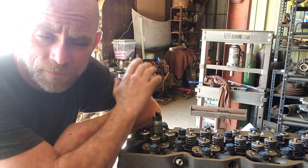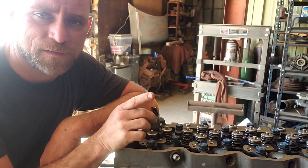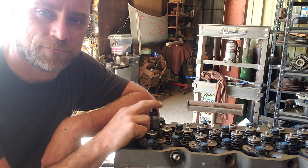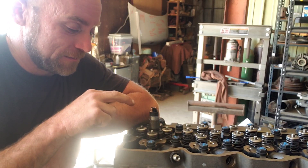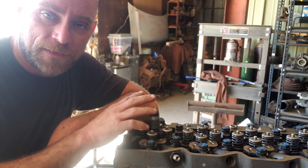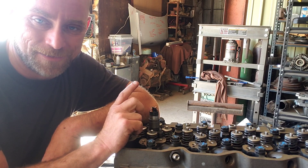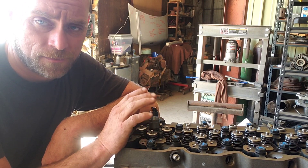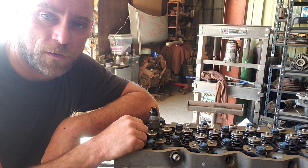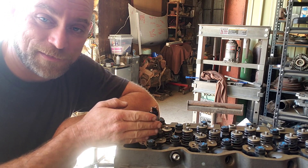The point of this video was these injectors — and I misspoke: I said 71 inch-pounds but I read the card wrong. It was 89 inch-pounds for the final bolt torque; I had it at 89, I just misspoke when I said it. That's how you put these in. The final torque on the studs on top for your electrical wires is 11 inch-pounds — make sure you get that right. Thanks for watching and I hope it helps you do your injectors. Really important — don't mess it up.